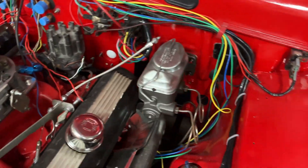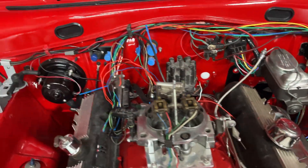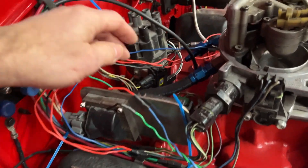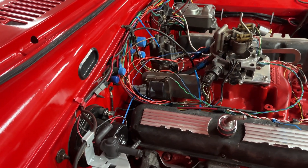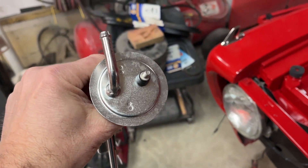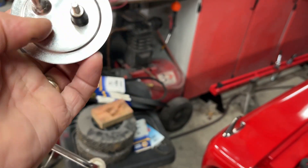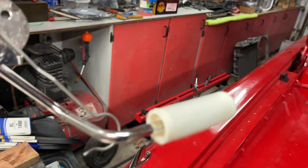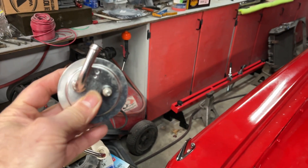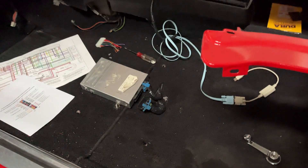So that's the basic components. I don't have the exhaust back in here, but oxygen sensor of course — that's pretty much it for engine components. For the fuel system, you have your fuel in and you have a return, so you do have to run a second line back to the fuel tank and get the excess fuel dumped back in somehow. What I did for my fuel sending unit was I actually modified it, drilled a hole through it, and put another fuel fitting on it as my return. That way you've got the pull right through the sock and another return right there, without having to modify the fuel tank. Up under the car by the frame rail I put an electric fuel pump, mounted with some rubber bushings.